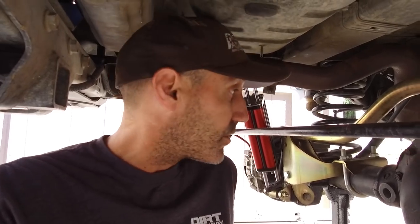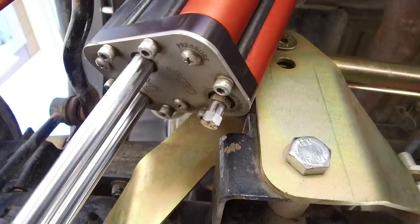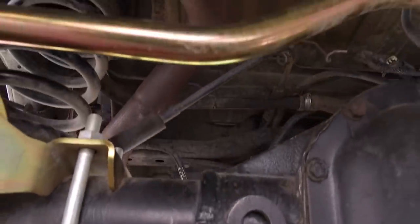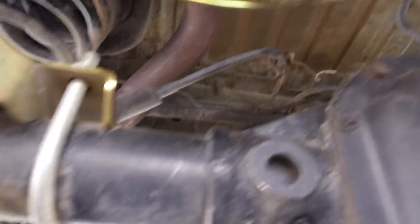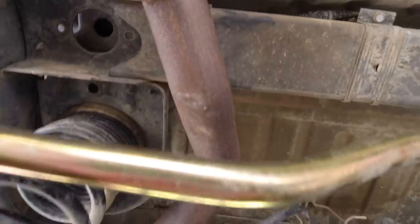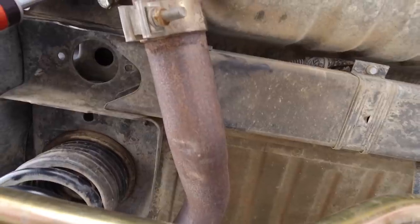No big deal — I took it over to one of my local performance shops, and for $15 they topped off the nitrogen on the upper and lower to 150 PSI, and the thing is tip-top, good as new. Now I have the Flowmaster American Thunder in this thing — many of you guys have liked the sound of it. Long-term performance: excellent. It's loud, but it offers great ground clearance, the stainless pipes are standing up well, and as you can see it can clank really hard with your track bar jumping in, and everything's okay.